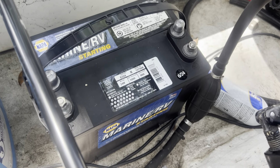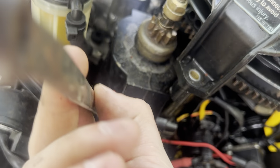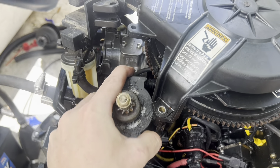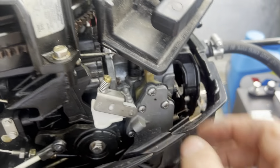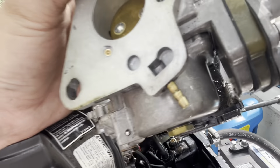Disconnect the power from your battery before you work on the starter. Now we're going to undo this bolt — once you undo both bolts you just pick up the starter and get it out of the way. We have this nut off and this nut off. We're going to try and lift it up, and then there's another hose underneath that we have to disconnect from the carburetor. You pull that hose off the bottom of this valve right here — this inlet, this jet, this hole.